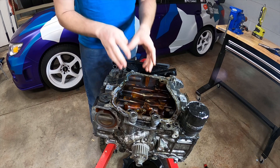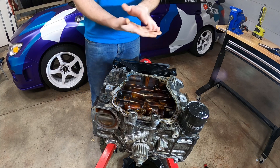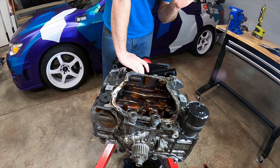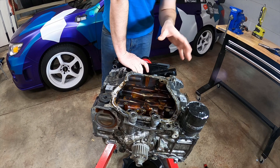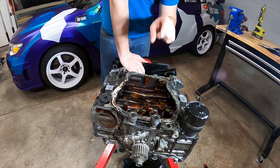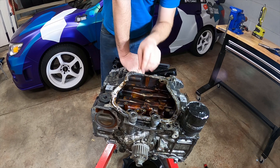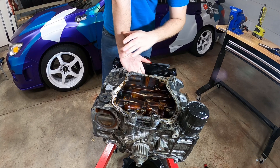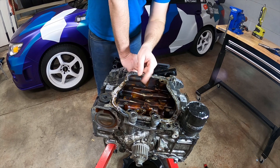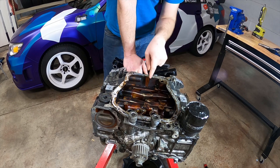We have more good news with the oil pan off. We pulled the pickup off and we pulled the baffle out — we're not going to be reusing the pickup or the pan just because that was all smashed. There was also only four bolts holding the oil pan in and absolutely no liquid gasket, which means this pan has been removed at some point. There was still a little bit of oil in here so it wasn't completely empty. Looking at the crank, the rod caps, and the connecting rods, everything looks okay. I've spun it and looked at the skirts of the pistons — everything seems good. There's no hot marks, none of the rods are banging back and forth like worn bearings. The inside of this block actually looks really good — the more we start tearing into it, the more it looks better.